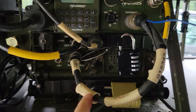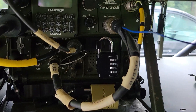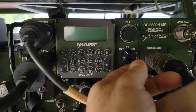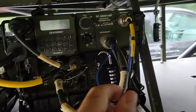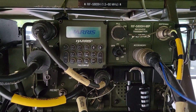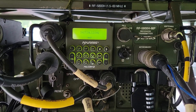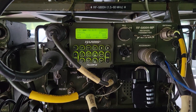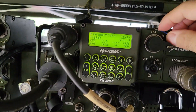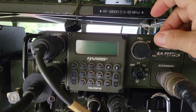Okay, so we've connected and replaced the original cable with this one. This needs some dressing up when I'm sure that this thing works. Here you can see the blue wire, which is the on-off - what I believe to be the on-off signal. Let's turn the radio on. I'm going to leave this open for now - open should allow the radio to power up in the normal state. And sure enough, you can see it's booting. Now we're going to take this and short it to ground, and there you have it: radio shuts off. And I lift it up and the radio turns back on.